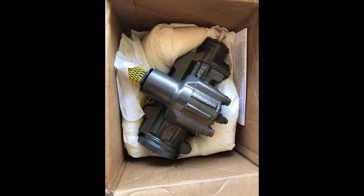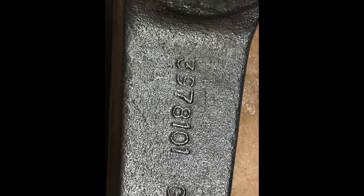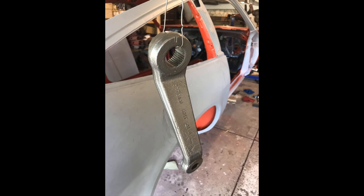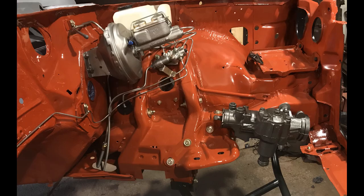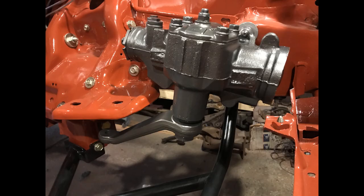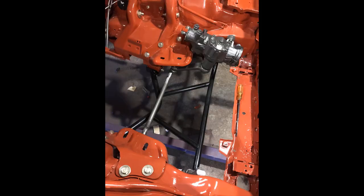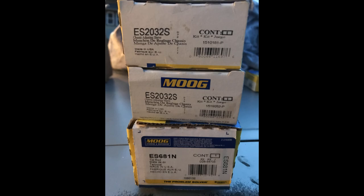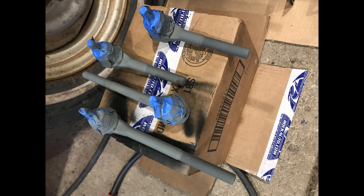Next up was all the steering components. I was a dummy and tossed out the car's original power steering box, so I bought a rebuilt one off of Rock Auto. Finding the Pitman arm was actually a real challenge, but a buddy up in Canada sent me one just for the cost of shipping — thanks Cam. It cleaned up great. I painted it and got it onto the steering box, which by the way torques to 184 foot-pounds. I got a new power steering center link off of eBay and cleaned and painted that to keep it from rusting as well. The steering box bolts missed the trip to the CAD plater, but the washers made it though. I picked up some Moog tie rods and they got the same cleaning and painting process and got installed. I tried to use Moog parts for everything I could — springs, center link, tie rods, everything I could get.